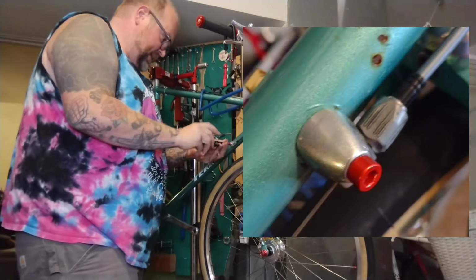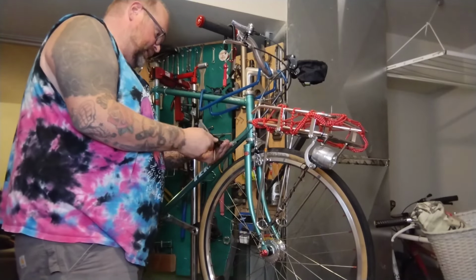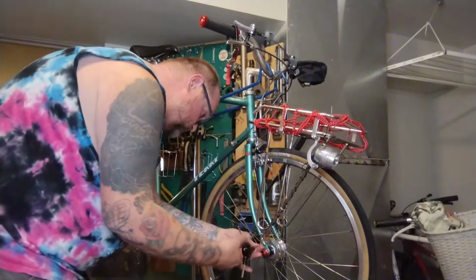And that took like 12 seconds. My camera didn't even turn off. So I just cut like 4 or 5 threads off, hit it with the wire wheels to make sure there's no big burr, and ran a stainless steel nut over it just to make sure the threads will start just fine. So just 2 or 3 seconds. Oh yeah, it's gonna have at least 6 or 7 threads holding it in. That is plenty. Let's do these rack bolts.